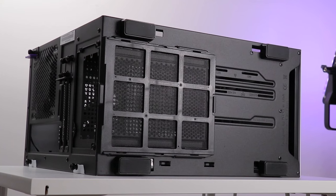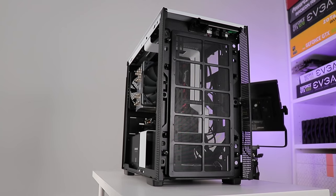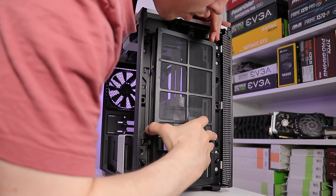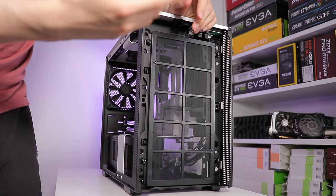Speaking of filters, we've covered the base PSU filter, but the front intake is filtered too — and thankfully it's filtered at the chassis point rather than at the side intakes. This allows the intake area of the sides to be maintained through to the opening of the chassis, rather than reducing the already limited intake area. It clips into the front fan bracket, and while it's a little awkward to remove since the clips have very tight tolerances — top tip: pull from the top or bottom, since if you pull from the side the two side clips re-engage. It's good enough for the occasional clean out.